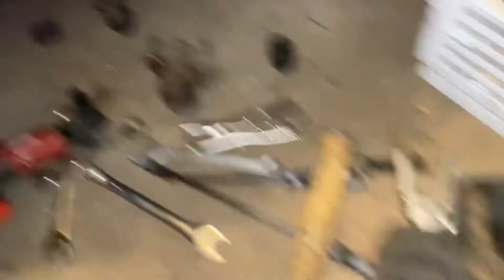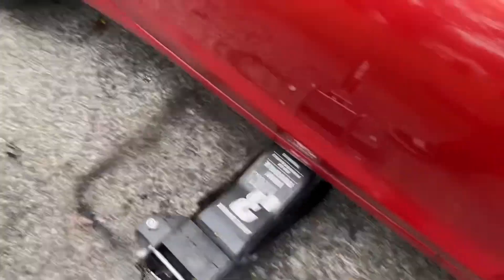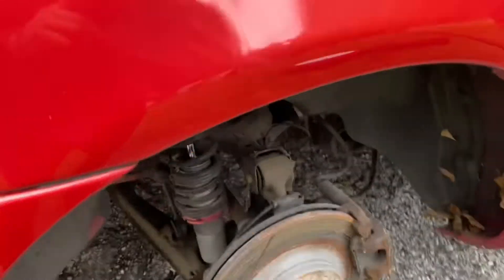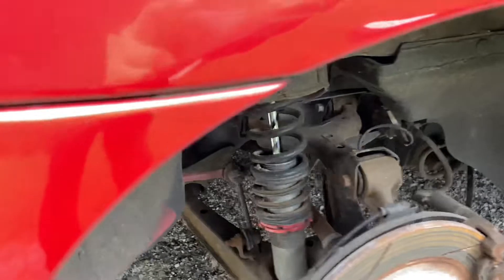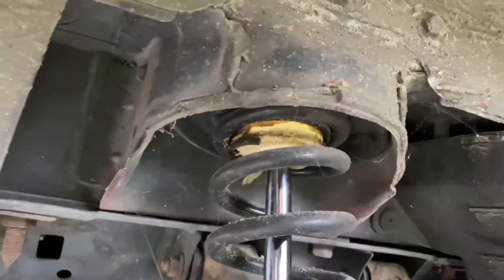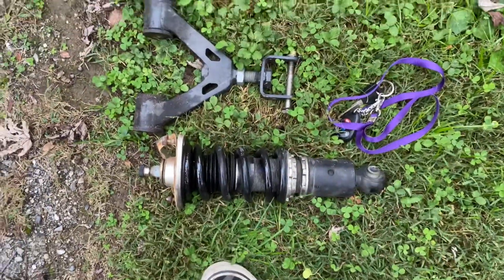Tomorrow we'll put them on the knuckle. Right now we just don't have a ball joint and the car is jacked up. Lug nuts are loose. Let's take off the wheels. Let's undo that coilover — bolt there, two nuts up there. Upper control arm is out, coilover is off. Now I'll put these beautiful babies in. Let's swap them.